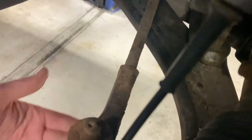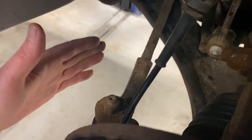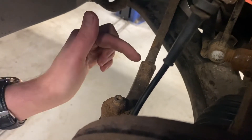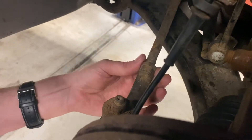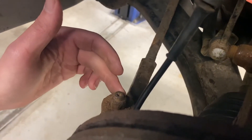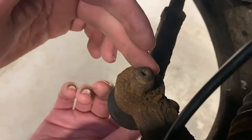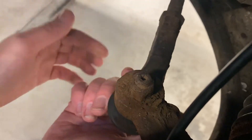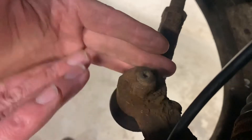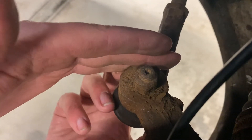First thing I'd do is clean it all up and brush everything, because as you can see this hasn't been apart before so it'll be a bit more difficult. I'd crack the locking nut off half a turn — no more than that — then set about undoing the nut. This is a nylon nut, though there's not much left because it's heavily corroded. I'd end up hitting the side — never the top, you'll damage it — hit the sides to give it enough shock to drop it out.